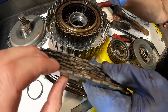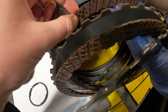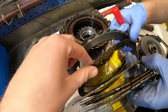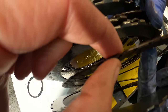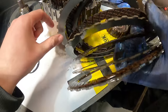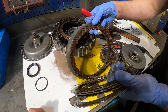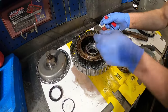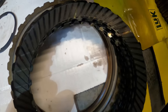How many frictions have you got in here then? One, two, three, four, five frictions. Some big clutch. They don't look in the best of condition either. I'd have liked to strip that original one down and compare to the new one. See that's got quite a bit of meat on it, but compare it to that one in the middle - there's a big discrepancy. They're not down to the bone though, there's not really any signs of significant wear. It's a wet clutch so it's oil cooled, not like a dry clutch.